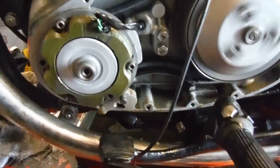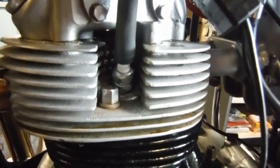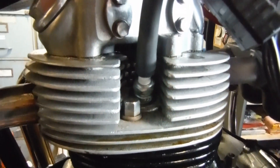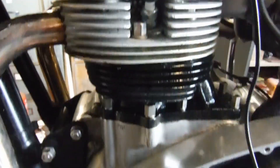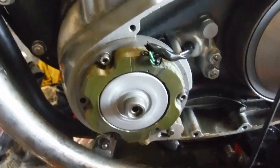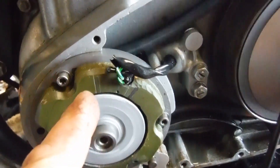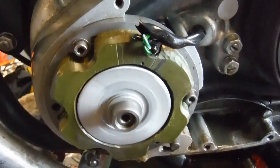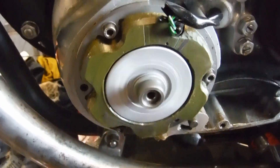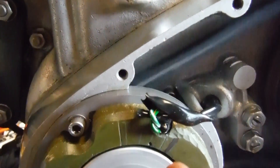I've already put the little spark plug tool in the plug hole, measured the same amount before top dead centre — almost 8mm before top dead centre — as the A65s have. And I've looked for a mark on the front shaft rotor, before the opening of the stator, around those positions. Sure enough, it's marked already there, highlighted in black.